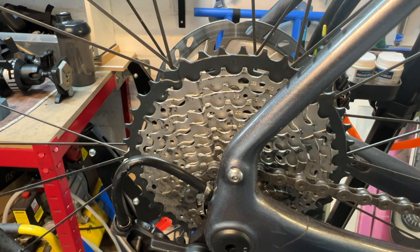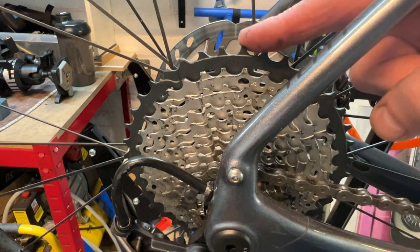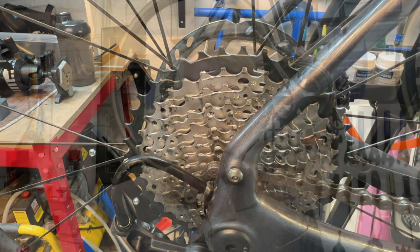And that would allow me to run the 31 to the 40, which is what this big sprocket here is, and that would run quite smoothly, and it does run quite smoothly. Well, there it is, it works. An 11 to 40 cassette coupled with a 48-31 chainring, some adjustments to the B screw, a couple of slight adjustments to the high and low stops, a couple of little bits of twitching on the indexing, and it all works sweet as a nut, as they say.